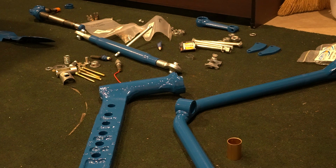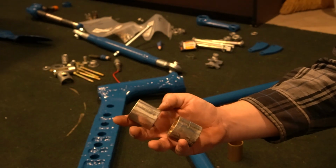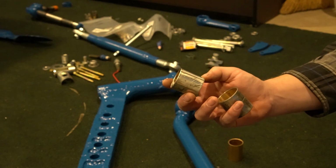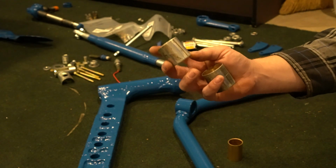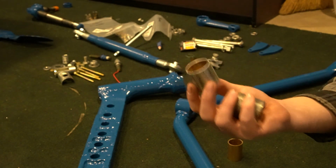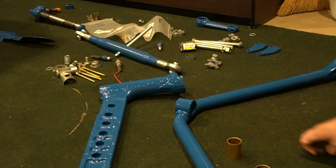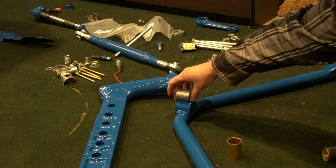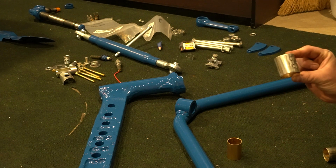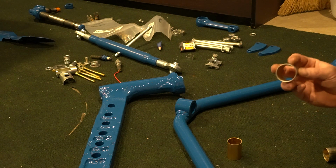And to do that, I got to put bushings in them. Your axle knee has these two bushings in it. The upper bushing is the same bushing as what's on an 8N. I think the part number for it is actually a 2N3109. This bushing is actually the same as the radius rod. The only difference is it's a little short. So you can use this bushing in the radius rod, even though it gives you a different part number. It is the correct inner and outer diameters.